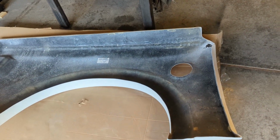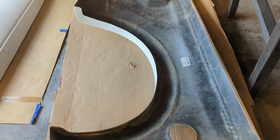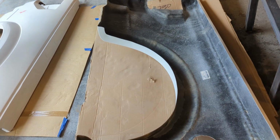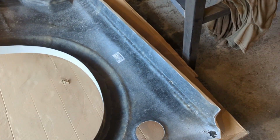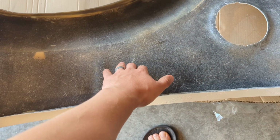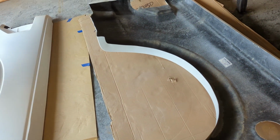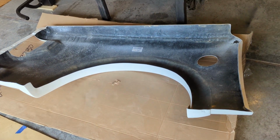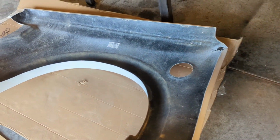The reason they do that is because fiberglass is kind of flimsy, and it has a tendency to crack, or spider crack and stuff like that. Also, rock chips coming in can tear it up and put little divots on the skin that you would see. So by bedlining it, it reinforces it, protects it, and makes it last longer. I have the Raptor Liner on hand, so I'm just going to use it.